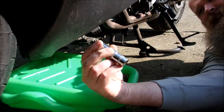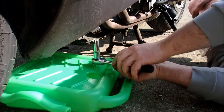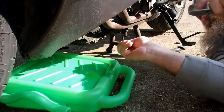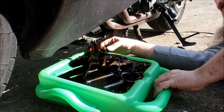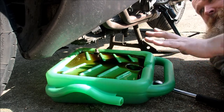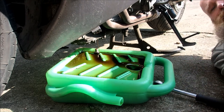We're going to take a 17mm socket and crack that open. With the oil drain plug removed, we're just going to leave that for about 15 minutes to make sure all the oil is out. We may even take it off the centre stand and lean it to one side to make sure, but we're going to leave that for a while. Once that's done, we'll then take off the filler.